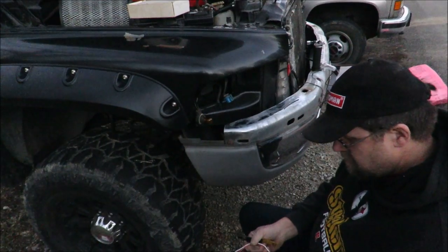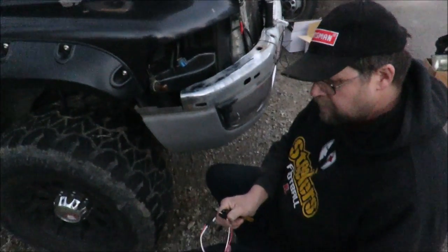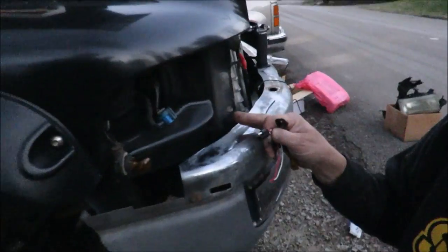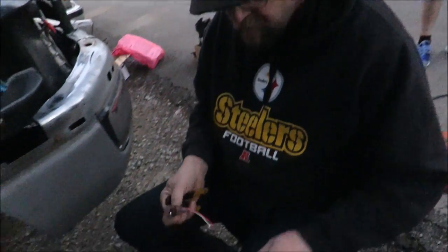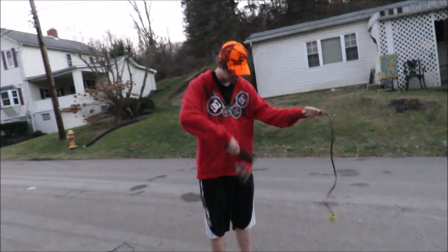When they sell these it's a watertight connector, same as you'd use on your trailer plug when you're pulling a boat or box trailer. This is only a two-wire one. This way in case we want to take the light out we don't have to recut the wires - it's a waterproof watertight connection. We'll solder that into both halves, one half to the light and one half to the wiring harness.